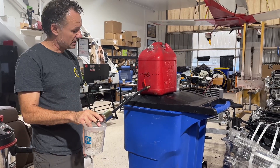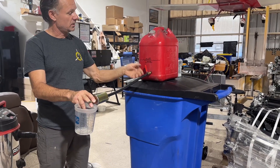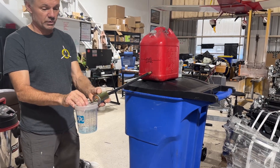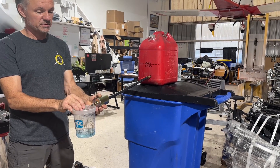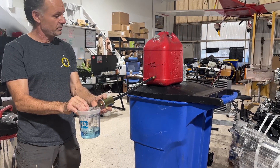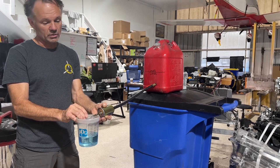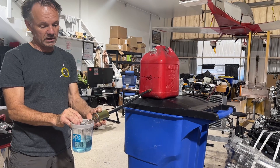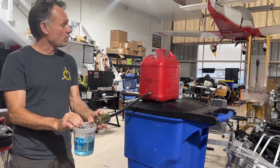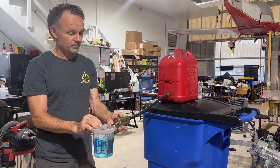This next test will be exactly the same, optimized for slightly downhill, but we have closed the ventilation of the tank. We'll see how it works with very little or no ventilation. Immediately it starts flowing. We'll see if it keeps flowing with reduced ventilation — sealed off with aluminum tape. Initially it's flowing just fine. That disqualifies any thought that the filters are preventing the initial flow of fuel, because it doesn't seem to. It's going to take quite a while to build up enough vacuum in that tank before we lose fuel flow.